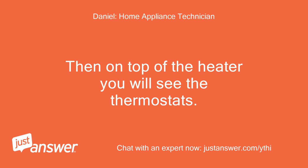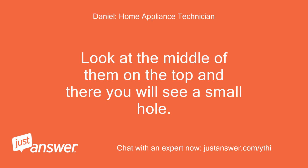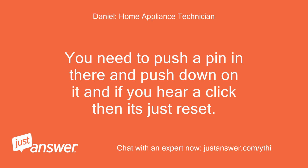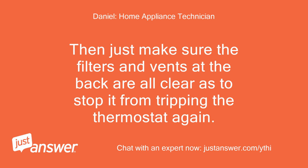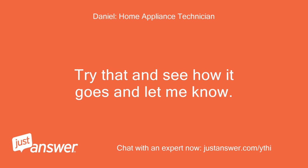Then on top of the heater you will see the thermostats. Look at the middle of them on the top, and there you will see a small hole. You need to push a pin in there and push down on it, and if you hear a click, then it's just reset. Refit the heater and retry it, and fingers crossed this cures the fault. Then just make sure the filters and vents at the back are all clear as to stop it from tripping the thermostat again. Try that and see how it goes and let me know.